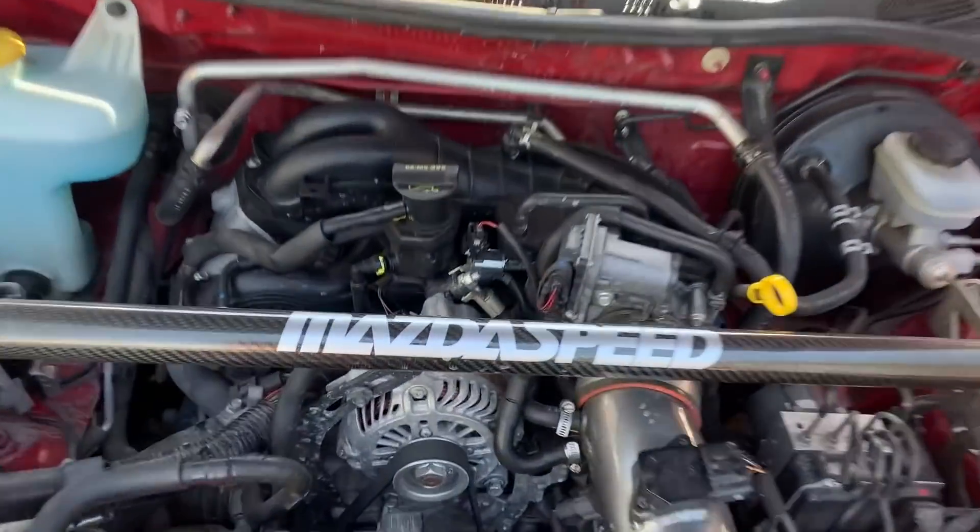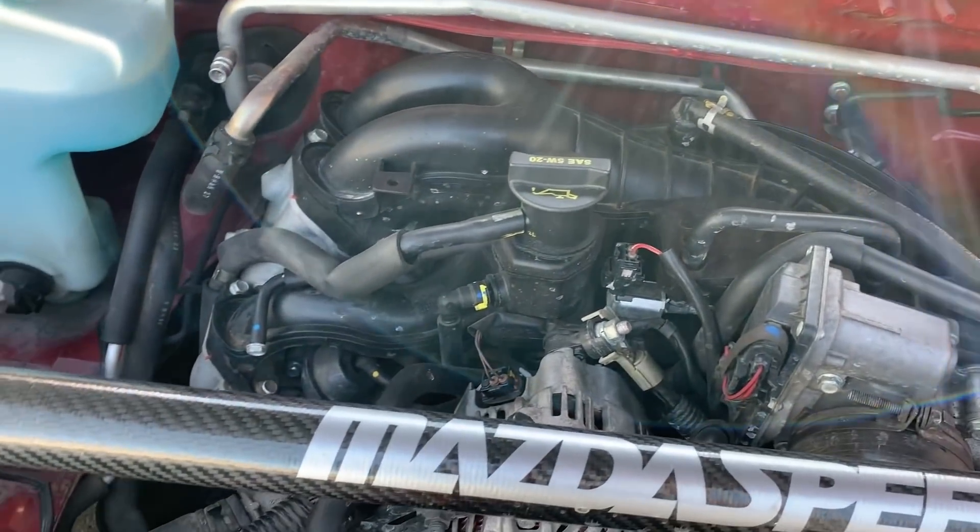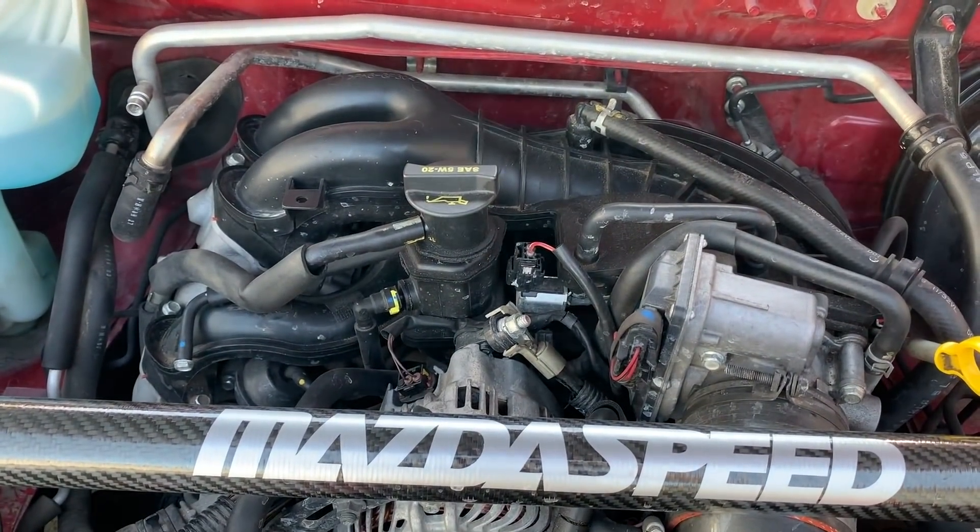For this last oil change interval I've been pre-mixing one ounce per gallon with the oil metering pump still hooked up. I've noticed my engine has been using less and less sump oil over the last oil change interval, which confirms my oil metering pumps are likely failing. That's why I've been pre-mixing at one ounce per gallon. But let's get to the main subject of this video — oil weights.